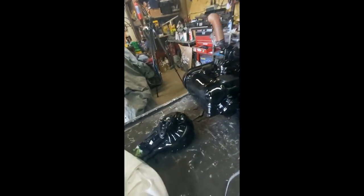Just painting the engine now — first coat of black already on. Excuse the muffled voice but I've got a mask on for the painting fumes. What I'm doing now is giving a bit of accent paint — that area will be painted black again and rubbed down, and several coats of lacquer will go on top of that. On the engine I'm using orange and I have to put it on when it's wet because I want it to interact with the black paint, then it'll be finished with two-pack lacquer.